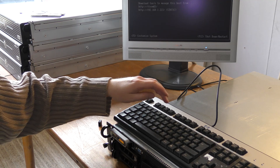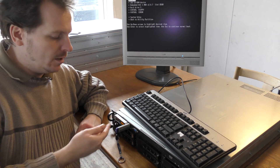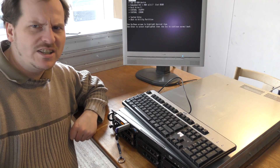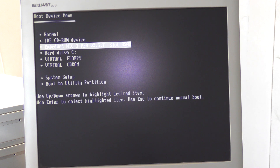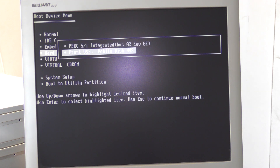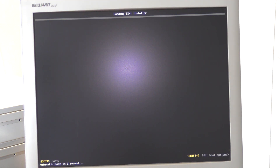I switched out the boot device because it didn't show up, and putting in another one still didn't show up. Let me show you what magical stuff this server does. Here is the boot menu and there are — as you can see — no USB devices, until you go down to Drive C, and then suddenly something appears there. There's a front USB hiding away underneath Drive C. So the first one I put in probably would have worked fine. We'll select that one and boot ESXi 6.0. Maybe we'll even get the option to upgrade.